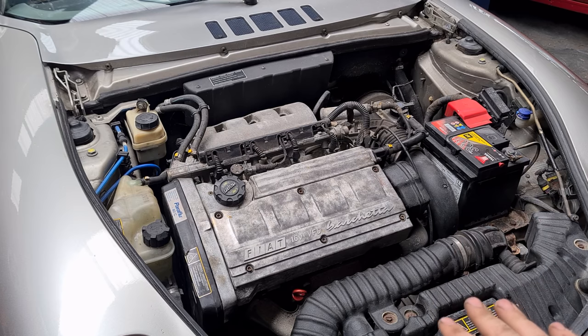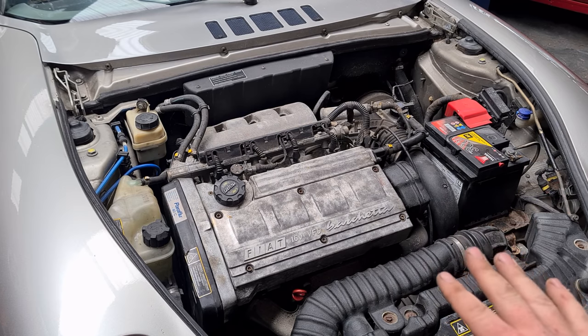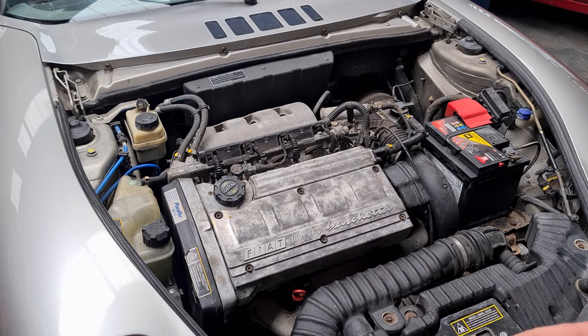Now, you've got some dry valves in there at the moment, probably just because it's not been running so long, so it will sound tappity at the moment, but as you can hear, that variator soon quieting down. Now it's got some oil in it, so we just need to let that run up to temperature now and make sure that's all okay.